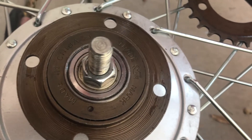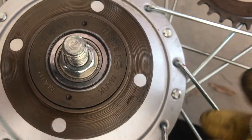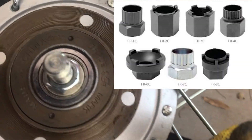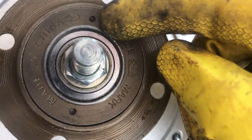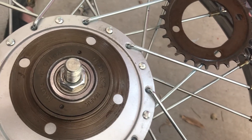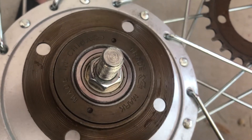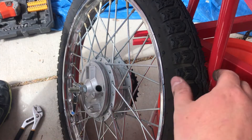I managed to remove at least the front cogs of the freewheel. Usually a freewheel has little splines where you stick a removing tool in and turn it, but there are no splines — it's completely flush everywhere, and I'm scratching my head wondering how this comes off. There are two little pins but that doesn't seem like a solid place to remove it. If I need it to be 28t, maybe I'll just steal this cog and leave the freewheel on the original wheel, because I don't know how I'm going to get this off.